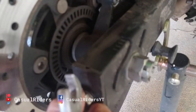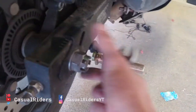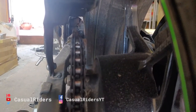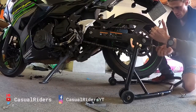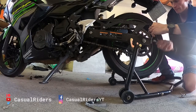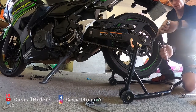You'll notice that this guide plate moves along the notches on the swing arm. The guide should be at the same point on both sides. However, you do want to check that the chain runs straight by looking down the length of it from behind the rear wheel. Once you're satisfied that it's all aligned up, tighten the tension nuts on each side of the swing arm, holding the adjustment nut still with a 14mm spanner.